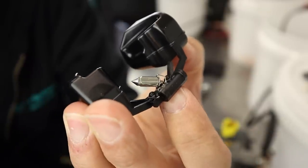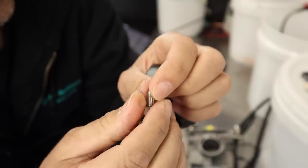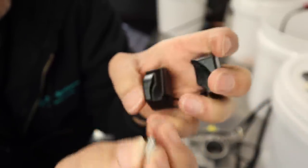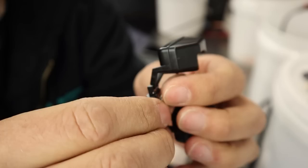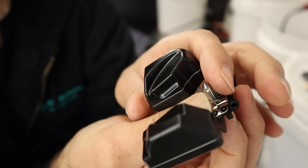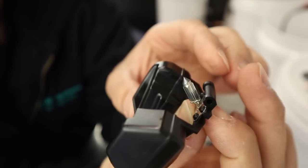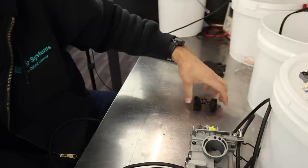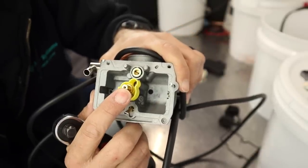Give the pin a little tap and the dowel comes out, then the float flies out — keep a finger on it. Hold it upside down and lift the float and you can see the needle that shuts off the fuel. The needle tip appears to be rubber — it's silver in color which is unusual, but if it were metal that would raise concerns about maintaining a good seal to shut off the fuel supply. When reattaching the float to the tang, be very careful — if you bend that tang, which is meant to be adjustable, you'll alter your float height. Bending it too much will either let in too much fuel or not enough. If you have a used bike spewing fuel, it's either that needle or the float being out of adjustment.